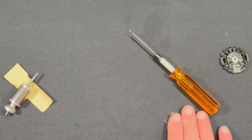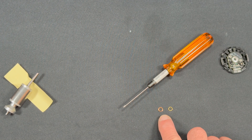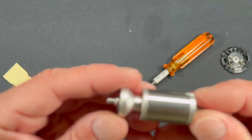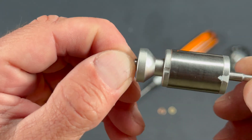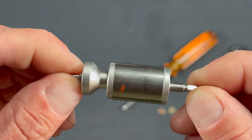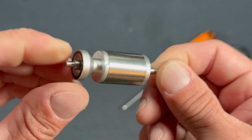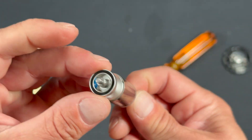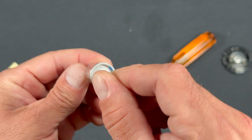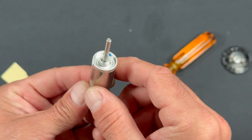You're going to get a wave washer and then a regular washer. The wave washer goes on the rotor side; the regular shim goes towards the bearing side. Here's the rotor — you see there it's sleeved so that it can't be exploded. Since we got it out of there with our super sweet install sleeve, we didn't cause any scratches or damage. That is a fancy rotor. You see your timing ring on the top. They are balanced — front and rear they are balanced. You see there's just a little tiny bit of material on the inside there.